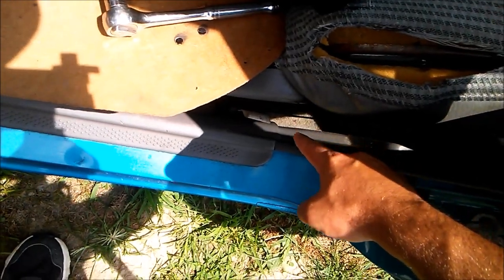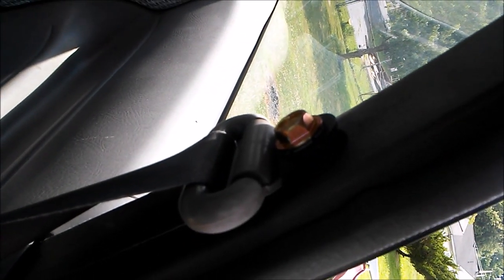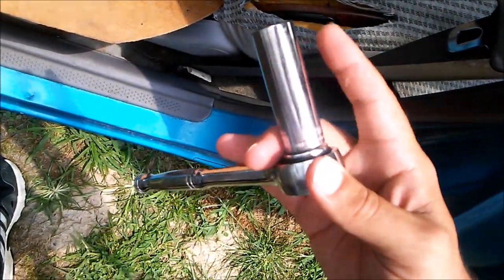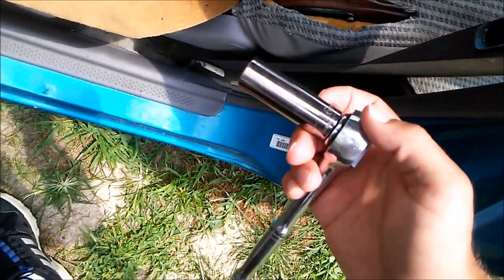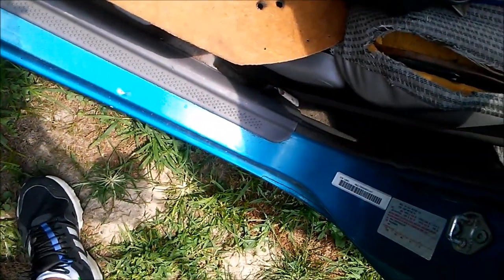You'll have one fastener down there and one fastener right in here, and that just flips right off. It's a bolt fastener. I already have it ready for you guys. 16mm — this is a deep socket. That's for the bottom one and the top. A 16mm socket will fit the bottom and the top.